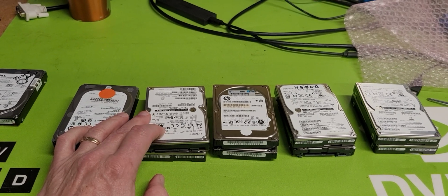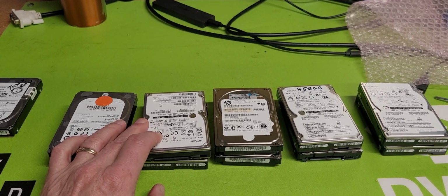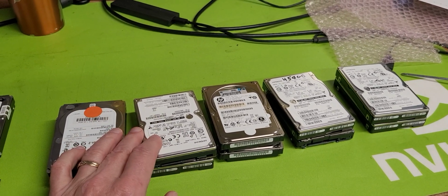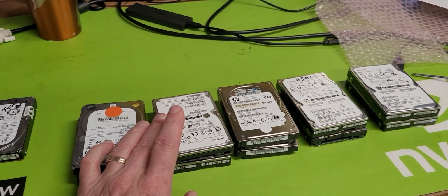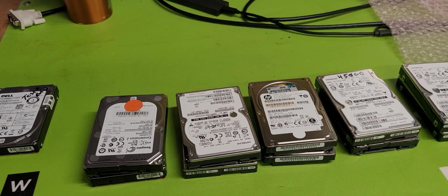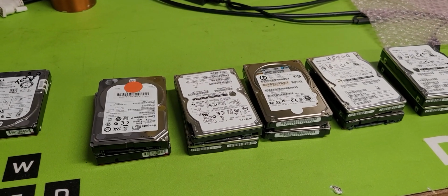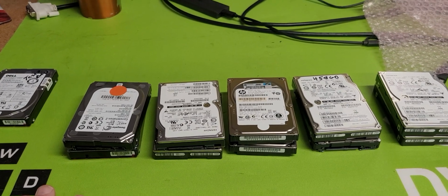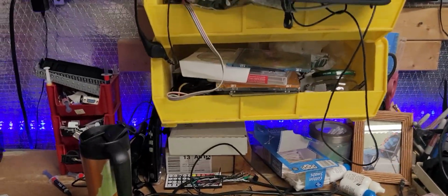Not a good idea. This is why NetApp will do 10 or 13 or 15 2246s in tandem using those cables you saw in the back to one HBA or two HBAs, and that's it. They don't add another set of controllers into the equation. They just put it all through one pair or a single HBA controller. So you need to be a little careful when you mix controllers, HBAs and RAID controllers. They can kind of come back and bite you. The biggest crucial thing to do is make sure that you block them off, you document them, you mark them, you clearly say in the volume names where these discs belong, and so on, so that you don't make that mistake, because it can be a kiss of death.